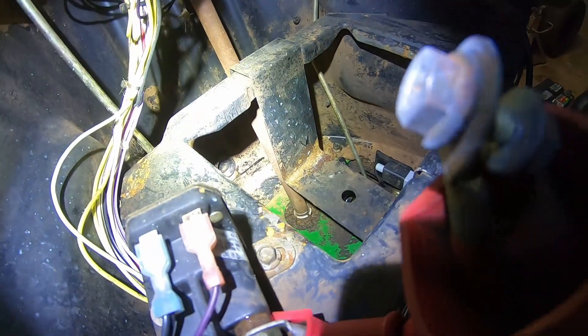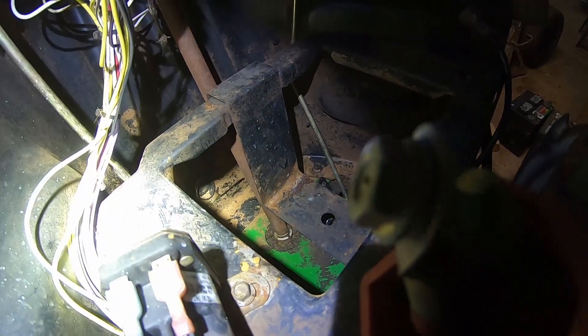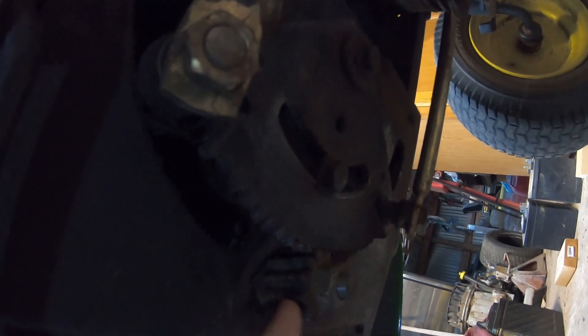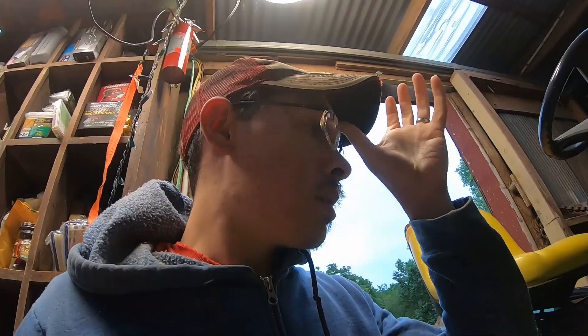You can see below the battery tray there — that's where the shaft goes through the frame and it's pretty loose. On the underside, I've already replaced this pinion with another used one but it's still awfully loose. There's a lot of slop. Let's pull all that off, get the new bushings in there, and get this thing out the door.